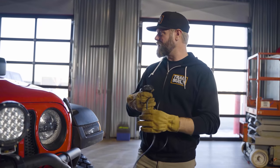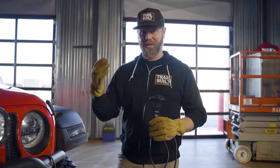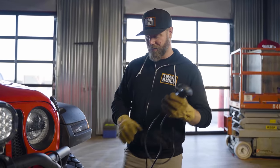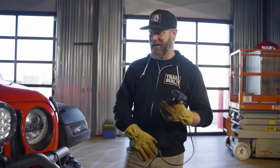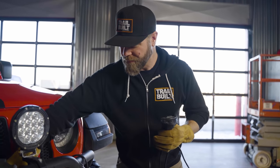If you're self-extracting, stay in the driver's seat and keep yourself out of harm's way as much as possible. If you do need someone else to run the winch remote, make sure they're standing as far out of the way as possible. Modern technology like Warn's Bluetooth-controlled remote lets you stand really far away, which is very safe. Before winching in, don't forget to re-engage the drum back into engage.